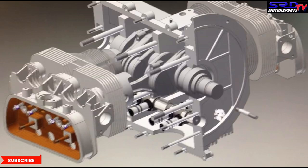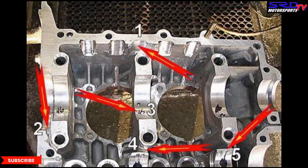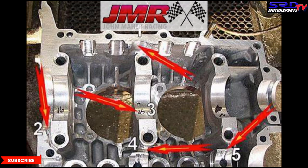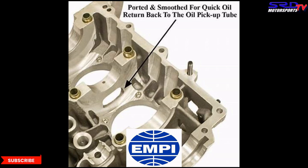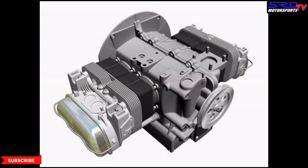There are tricks to help the movement of air underneath the crankcase. Here in the Beetle stuff, this is from John Maher Racing from the UK — here is the inside of the VW case. You remember the air moves back and forth, so you clean up these areas just to alleviate the pressure and make it easier for the air to travel, including the oil drain. Even the EMPI case brochure talks about that — look, this window is ported really well, and you can port it even better to smooth it out.